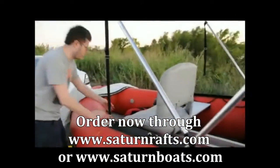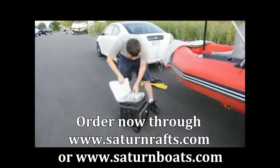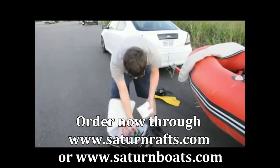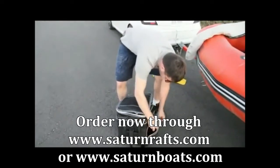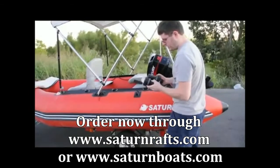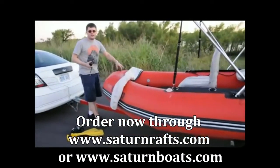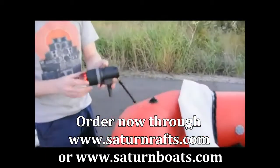A couple of things you're going to want in your boat: one life jacket per person. What I have right here is a cooler with a pocket inside. You're going to want stuff like a waterproof case, light sticks, a knife, pliers, your registration, zip ties, some extra latches. I also have a light kit for night use — the back light attaches directly to the top of the outboard motor mount, and you need a white one that goes all the way around. For the front, you glue a fitting to the bow — this snaps in and locks in, with your standard red on the port side and green on the starboard side.